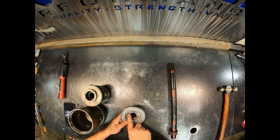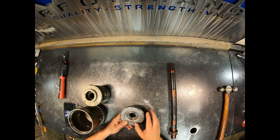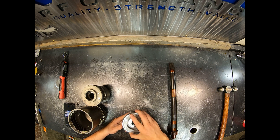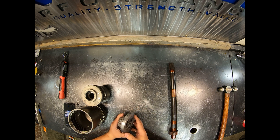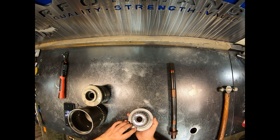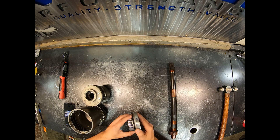Also check right here for any scoring — that's kind of a thrust surface. This one's fine; as long as you can't really feel any of that, you're good to go. You also want to look for cracks in this housing assembly, and be careful when you press a new bearing on here. If you press too hard it's quite easy to crack this with a powerful press, so just watch out.